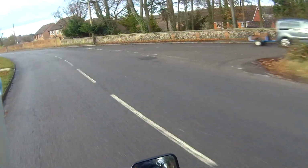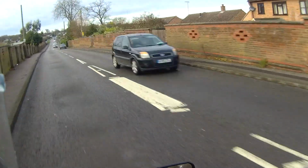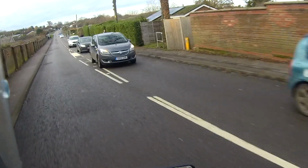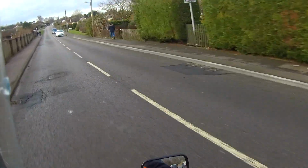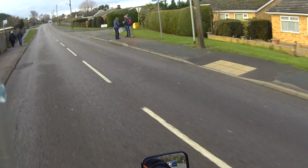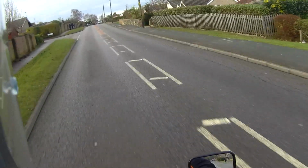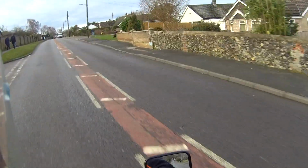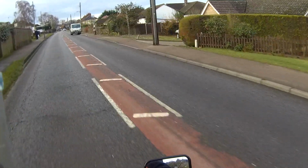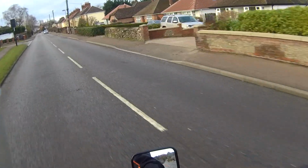And when I took the back chrome tailpiece off the exhaust on this, it's quite open inside, it's got two chambers. It's not a lot different to the DRZ exhaust. The DRZ exhaust just has one little chamber right at the back. This has got two, so it's definitely louder. It breathes better than a standard DRZ UK spec exhaust, and it certainly sounds better, so I think we will stick with this for now.